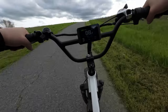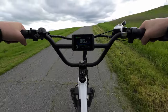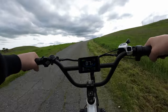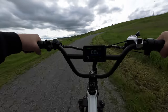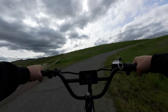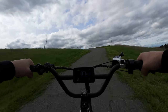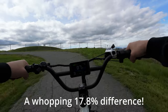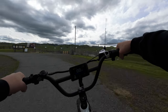Oh yeah, quite a big difference — I can already tell you right now. My pedal is loose, which is throwing this off a bit, but we'll address that when we get to the top. This is significantly easier — significant easier climbing experience. I don't know exactly what the math is, but a 46-tooth compared to 56-tooth is well over 10%, probably around 15% difference. Coupled with the 18% already gained in the back, they tackled this hill no problem in pedal assist 3.